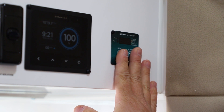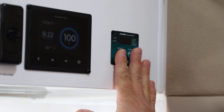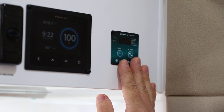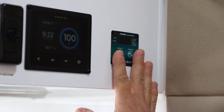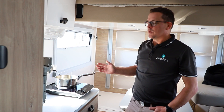It is always recommended that when free camping with no AC power available, you turn off the inverter when it's not required. This reduces standby current draw considerably over a 24 to 48 hour period, helping maintain all the battery capacity you possibly can. That's the functionality of the transfer inverter from the remote control.